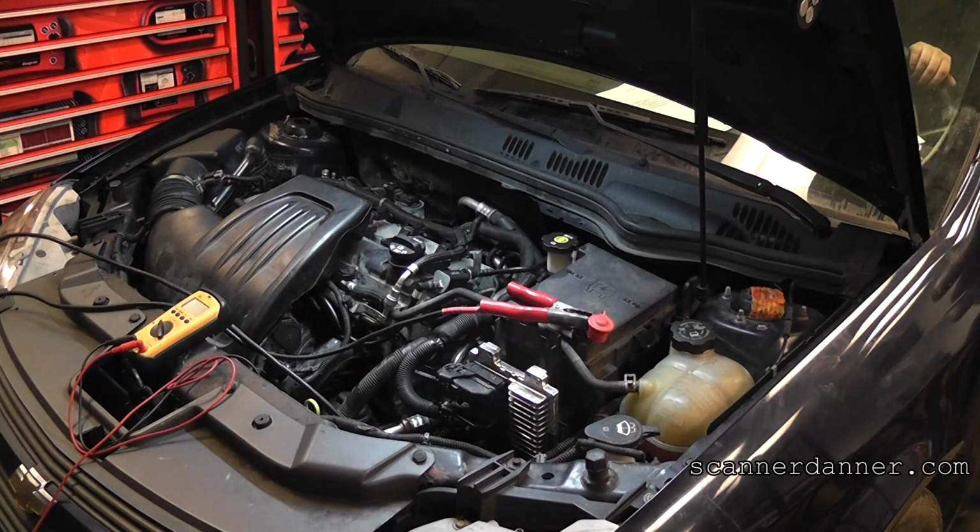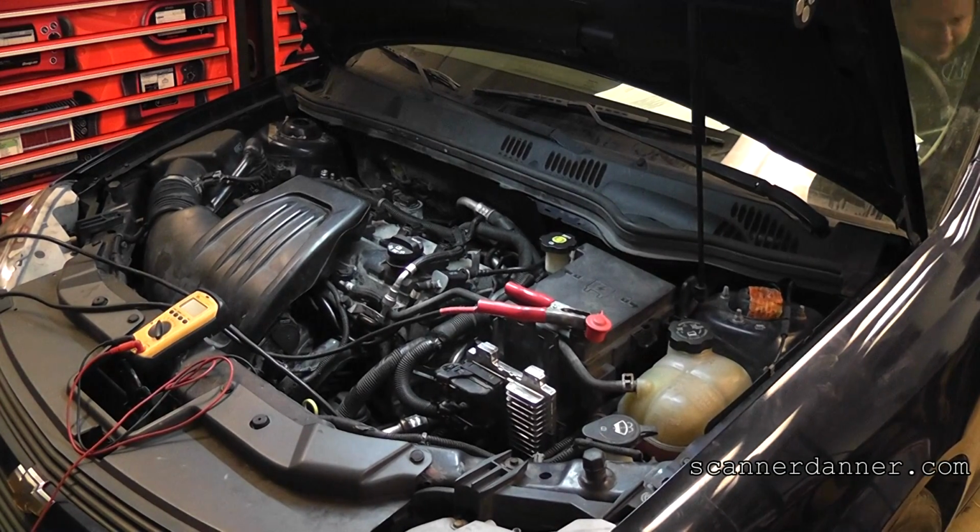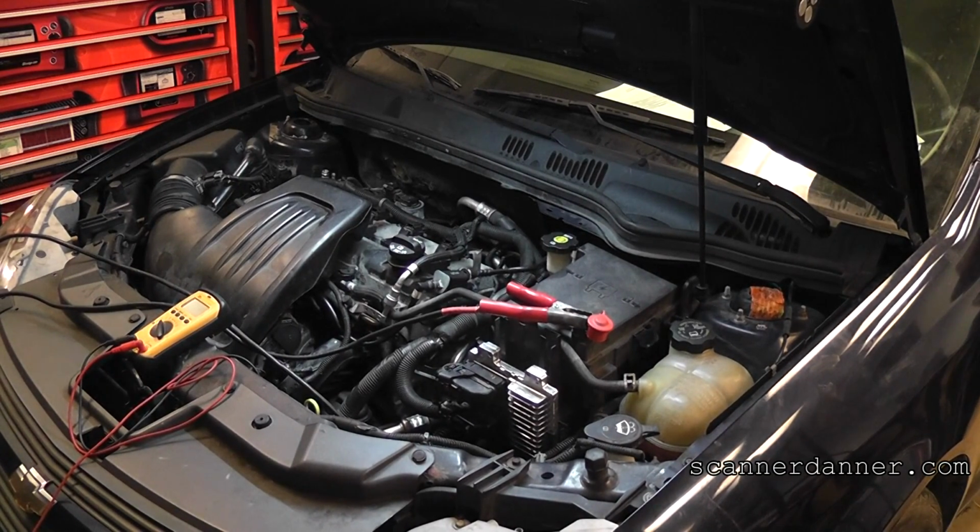But here's the first thing. The ignition crank circuit, leave the key on, Scott. You can stay in there, that's fine. The ignition crank circuit of this car is computer controlled. The computer controls the starter relay on this, and you can watch part 1 to catch up. I left off my part 1 video going through reference circuits, going through a no crank. It didn't crank on its own. Going through a no communication, and I was walking through the reference circuit, and what we suspected in part 1 is that we needed a computer.